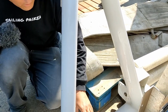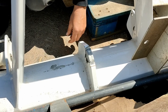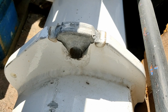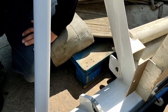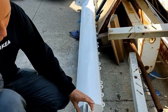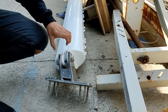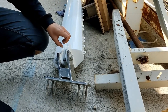It's quite a big lump of alloy and it's welded on. There are things that aren't so nice about this arrangement, but it works — it's done 43,000 to 45,000 miles so I can't complain too much. There are better solutions with alloy these days, but this is an old-school method that's worked very well. At the outboard end, this connection is only designed for vertical and compressive load, and is definitely not designed for any torsional load. Any torsion here will basically twist and buckle these plates because they have quite a long span from the end of the beam.